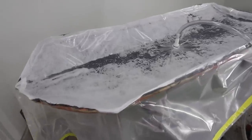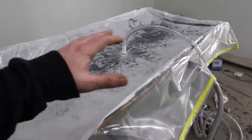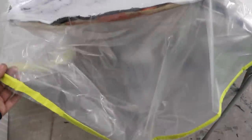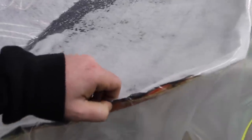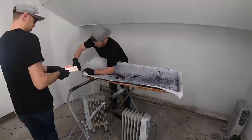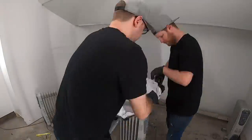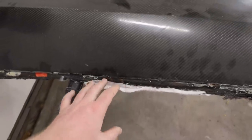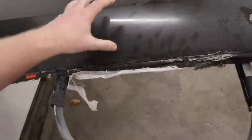I had to go out of town for a few days with the car over to the body shop while the roof was getting done, so I let Kyle take over and build his first carbon fiber door skin. He went ahead and did three layers inside the mold — resin, peel ply, breather cloth — then vacuum bagged it up. We're going to cut this vacuum bag off carefully because we want to reuse it for another part coming up soon. We got the piece out and pretty cleaned up — our edges are rough just like on the other mold, but we have a plan: after bonding onto the door we'll use a little body filler to clean that up. Kyle's going to come through with the cutoff wheel and cut it so we just have the skin we want.